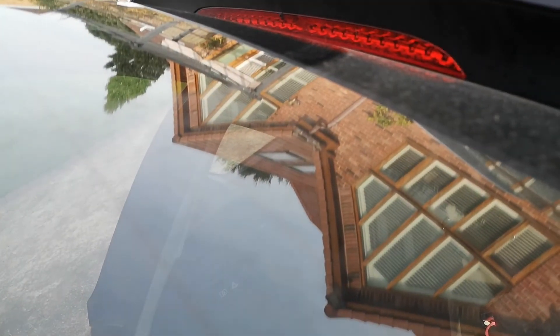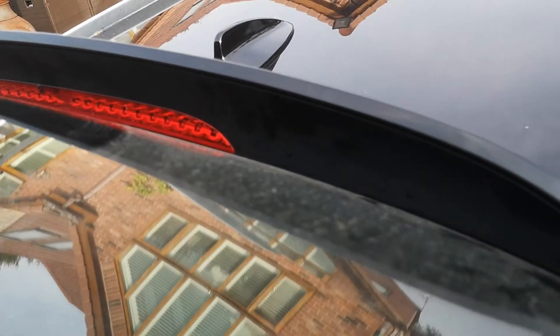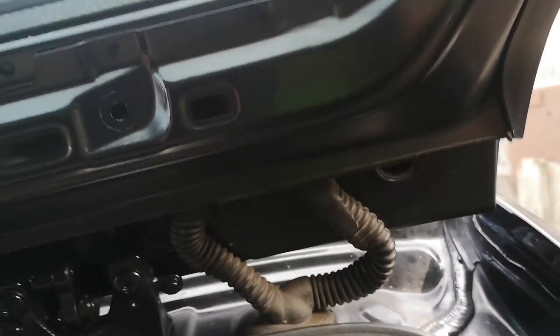Hopefully that can be seen - there we go. It contains the third brake light. So there are two bolts behind rubber caps: one from there on the right hand side, and one from there on the left hand side. And then you're struggling looking for extra fittings.